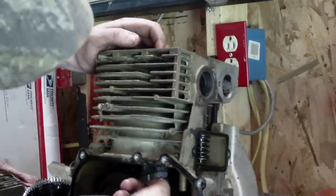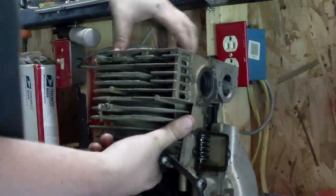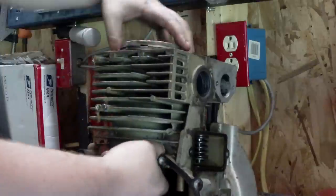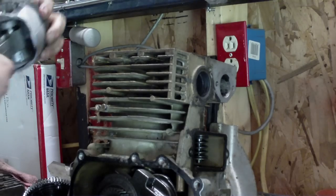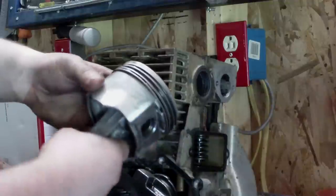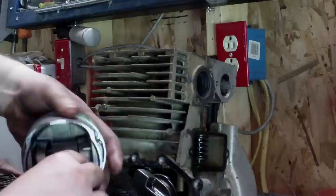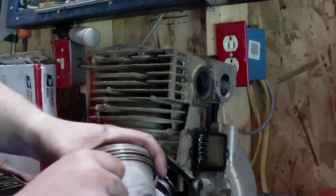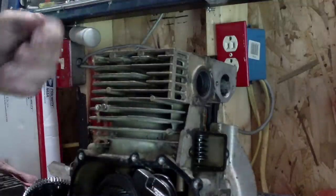What you've got to do is get a hold of the rod here and press up on it. You'll see the piston come out. Sometimes they're harder to do. Be careful that the rod doesn't hit the cylinder wall because of a scratch. Here's the piston — this seems like it's in pretty good shape. There's a couple of light score marks on it. The general rule of thumb is if you run your fingernail over and you can feel them, then they're pretty deep and the piston should be replaced. The same for a cylinder — if you can feel them with your fingernail, it should be bored out.